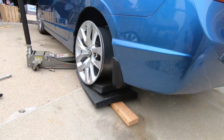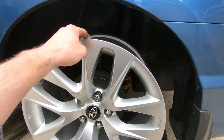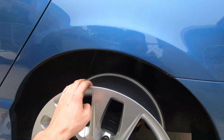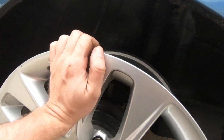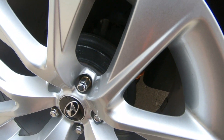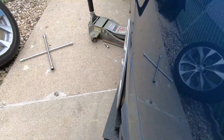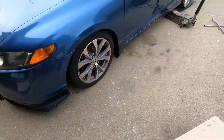She's all the way down on the ground. One thing I hate when you get a more aggressive wheel and it sticks out further — your actual ride height looks bigger. When I was tucking with the SI wheels it looked a lot lower, but once you bring the wheels out, I don't know if it's an illusion, but it makes it seem like you need to go even lower. In the back we've got a good inch and a half of clearance with the cover for the fuel line. Everything else is fine. I'm running drum brakes in the rear so calipers would clear no problem. We are hella flush right there.